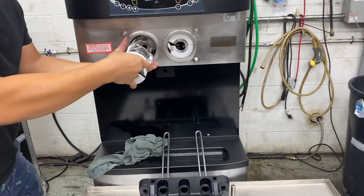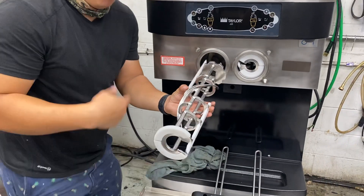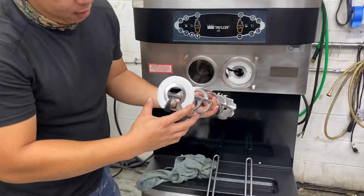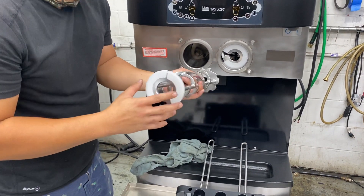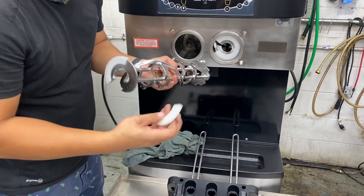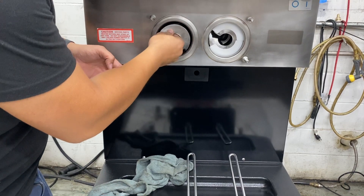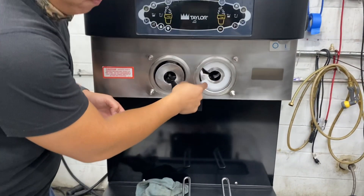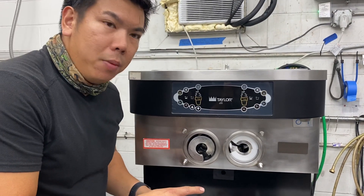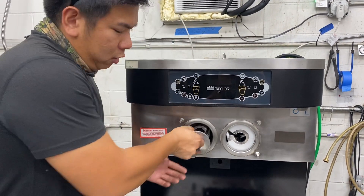The next thing coming out is your auger assembly. This might look a little different from what you're used to on a C713 or 794 — similar but different. For pump machines, there are two separate scraper blades and plastic guides that fit onto it. When assembled, this forms a nice flush seal with no play. If you take the guides off you'll see all the play — that's what they prevent. If they're worn out or missing, when you run the machine you'll hear a loud clacking noise because the assembly is bouncing around with nothing stabilizing it.